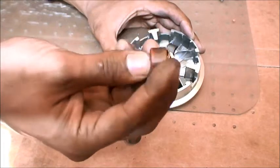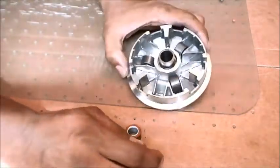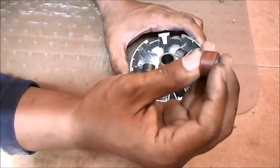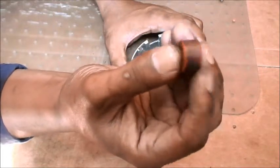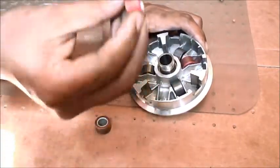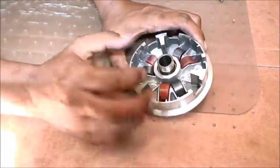These Polini rollers are very good. Some of you may remember on the forums that I went on a ride — I was doing 55, 65, even up to about 75 for brief periods of time — and my average speed was probably around 55 to 60. I have just the most minute flat spots, not enough to make a difference — they're basically just broken in. I really like these Polini rollers, and they can be had for pretty cheap at Spy. You always want to check these things every couple hundred miles or when you start noticing performance going down.